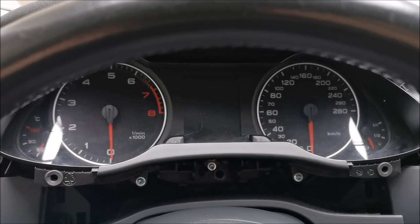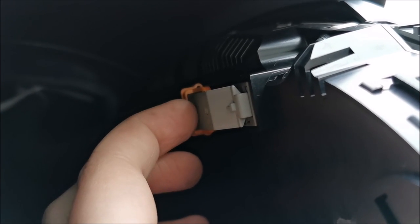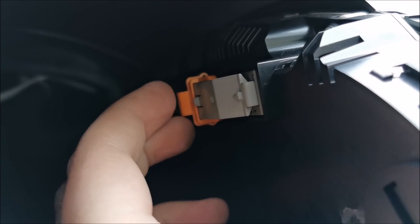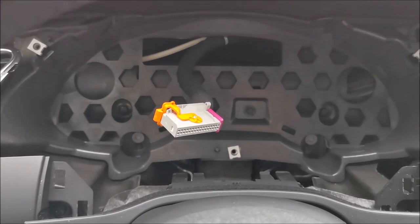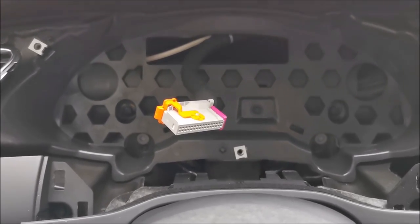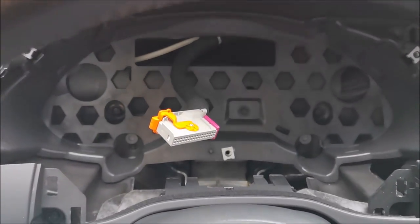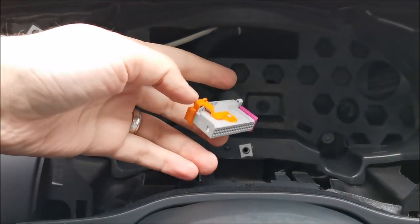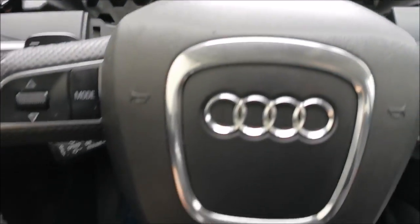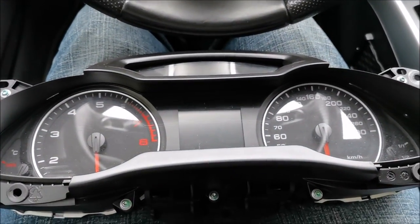Now I need to remove the plug from the back of this thing. This orange piece needs to come towards us and clear that clip. So I need a screwdriver to push the clip in a bit and push this orange piece, which will unlock the whole connector so I can get it out. And that's exactly how it's done. Don't mind that white cable — that's the cable I installed for my center speaker because this car had a really poor sound system. That video will also be linked in the description. So yeah, this thing simply unlocks and now we are left with this cluster to take inside and tinker with.